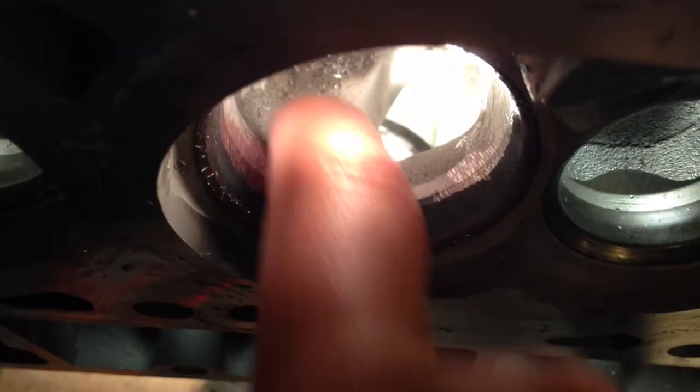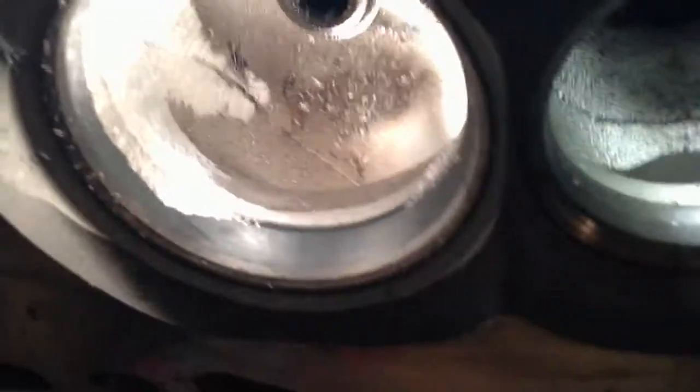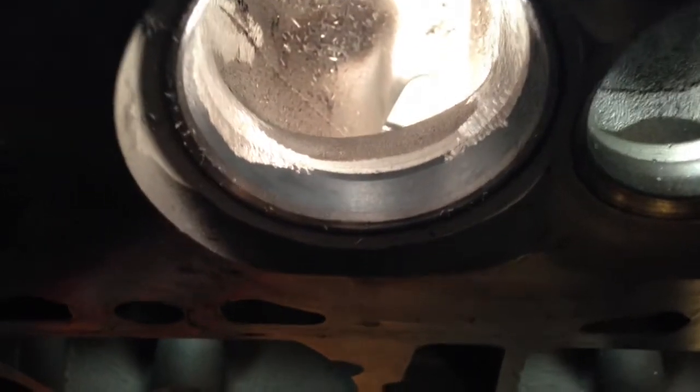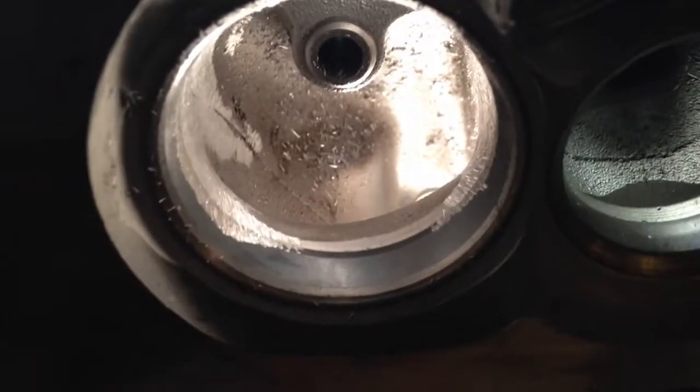I'm going to go ahead and smooth this. And the short sides on these are not bad. I mean, GM does a pretty nice job on these things from the factory. That's why it's kind of an upgrade head, the TFS upgrade head for the LS guys. Not like I know, because I'm not really an LS1 guy. But we'll go ahead and get hacking at that.